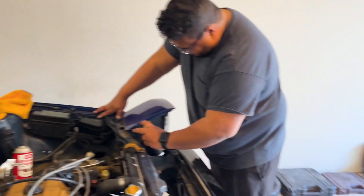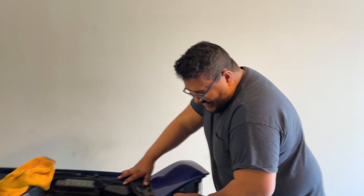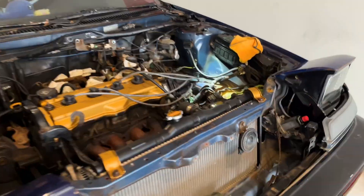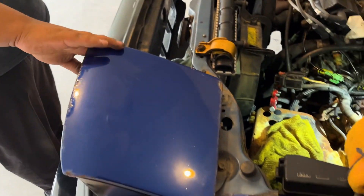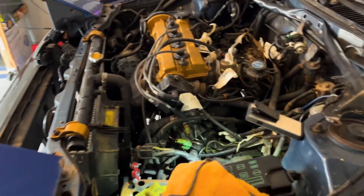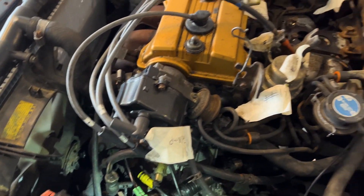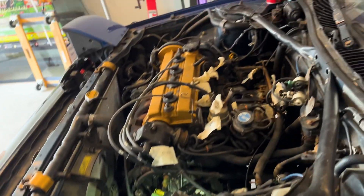The radiator brackets and headlight assembly aren't going to fasten themselves. My brother put the top caps on and the headlights — he managed to strip them so they'll stay on forever. Three of the four bolts are in there. We got the connections on, the motor mounts on. We're going to get the rotors, brackets, control arms — pretty much everything in this general area — put back together. And then we're finally going to adapt the Weber carburetor.